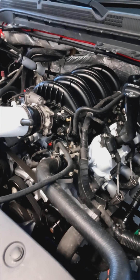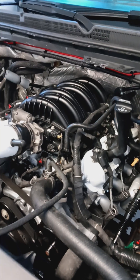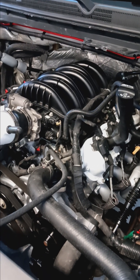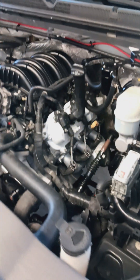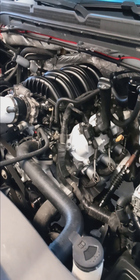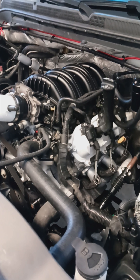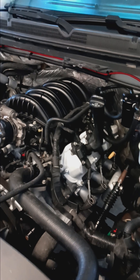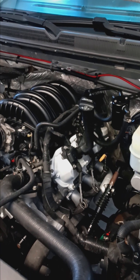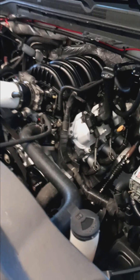Obviously you can go with the V8 and the sky's the limit — building NA, turbocharging, supercharging. With the V6 you are limited, but costs come into play. I'm realistic — this truck is not going to turn 12s or even 13s in the quarter. I just wanted a more peppy truck. This truck was tuned before I did the swap and everything, and it is pretty close to a night-and-day difference. I've got a ton more power in the mid-range — anywhere from 1,800 to 4,000 RPM the truck feels peppy and light on its feet, despite having a 3.23 rear end.